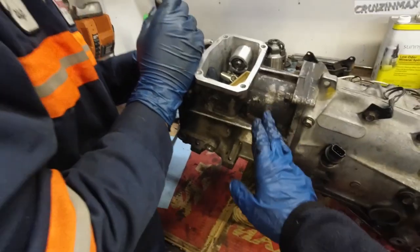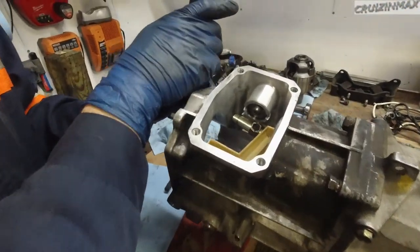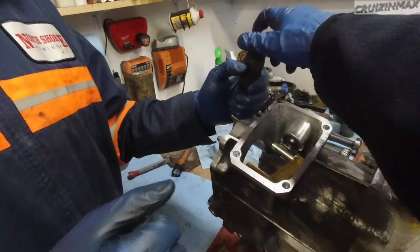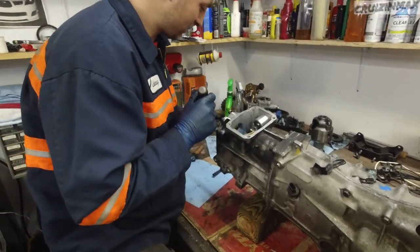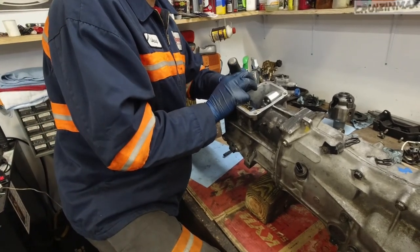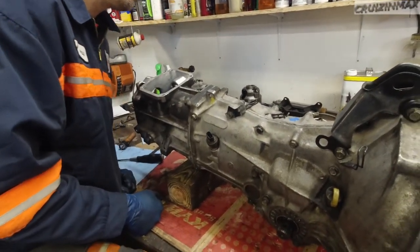We're good for now — this is temporary, we still need a gasket from the dealer so this is going back off again, just for testing purposes. We picked third gear to test: it does not go side to side, which means it won't slip out. We do have some side-to-side action in neutral. Reverse makes that different sound, which is normal.